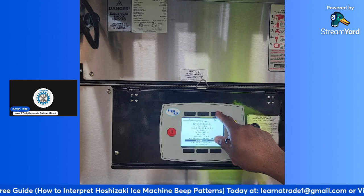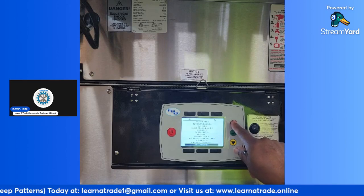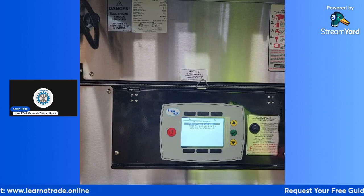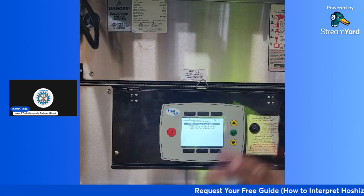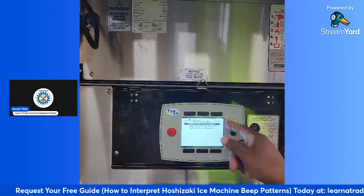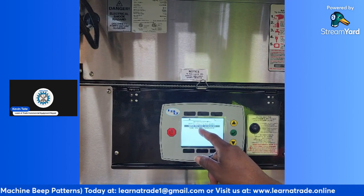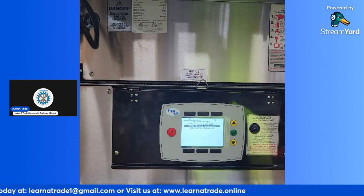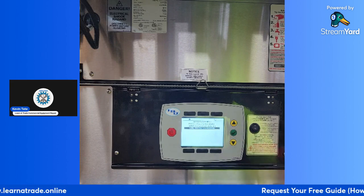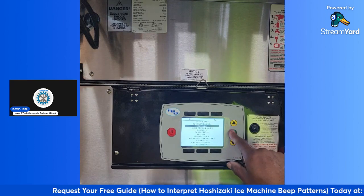When you want to go out of a particular part of the menu, you can just hit back — that's the back key right up here. You can go to machine totals, stuff like that. I'm just going to go back up into the maintenance menu. When you want to empty out the barrel and refill it, you go there and go to purge, fill, drain barrel. So everything is pretty clear on these. Right here is your water and Brix calibration — that's to calibrate the water flow rate and do your Brix — and then your voltage calibration. It's all in there. It's a really good system and machine.